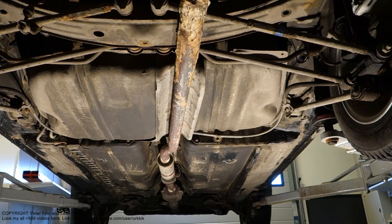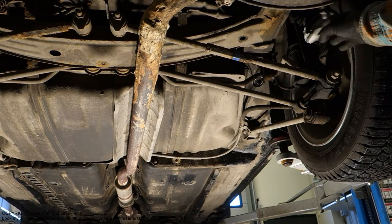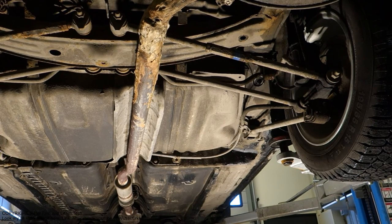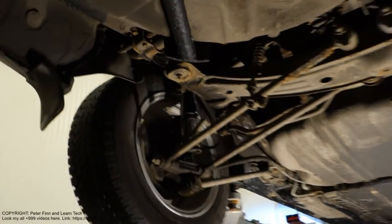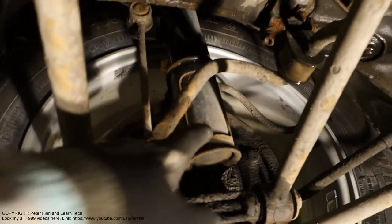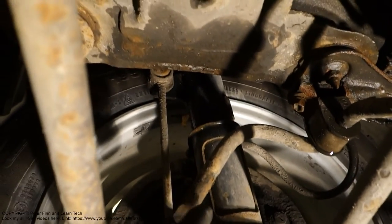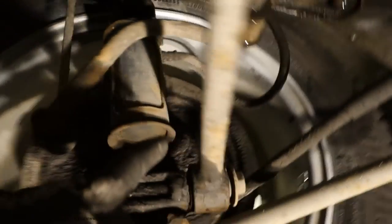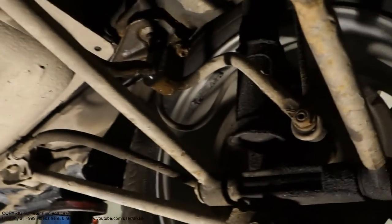Okay, and now when we are looking and searching for these oil leaks in the shocks in the rear area and also in the front area, it's good to start by looking at all of these shocks very carefully with a light. The idea is that if we can see that the shock is dry, like in that one, the shock is okay, and there are no leaks in here or in any areas. This is fine. That means this left side's shock is okay. And then we go to look at the right side.